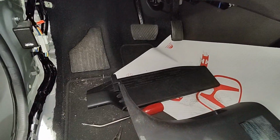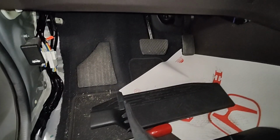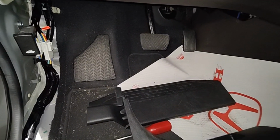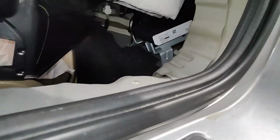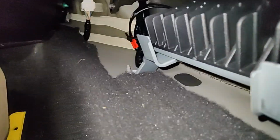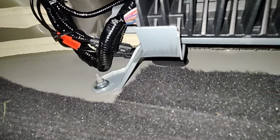We're gonna go into the back. We're gonna remove that panel, and I'm gonna unplug the amp and then see if it still pops the fuse. If it doesn't pop the fuse, then we're replacing an amp. Okay, I just removed some of this and then this. I'm not gonna remove the entire panel because, from doing a lot of Fakras, I can do them without removing this panel here. I just gotta reach my arm in there, and with my camera I can see which connector is there.